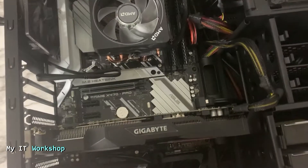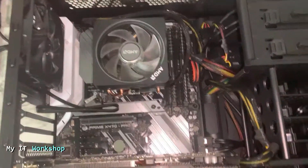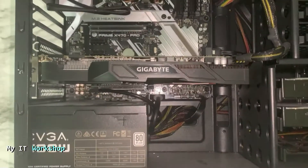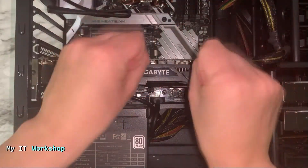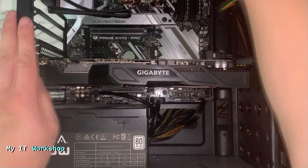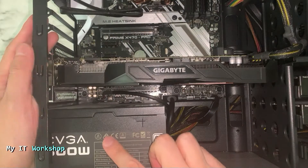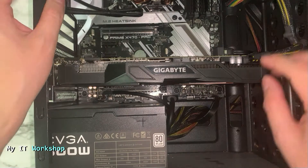Let's bring the case over. Allow me a few seconds to adjust my camera. This is the power supply we're going to be removing. Before I start, I want to show you that I'm not wearing any jewelry or watches, and I'm going to discharge any static electricity by touching the metallic case for a few seconds so I don't damage the circuitry.